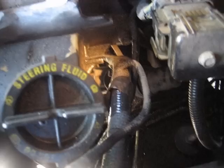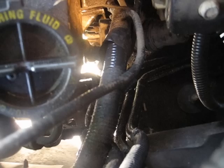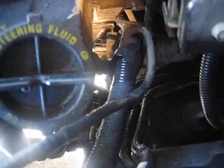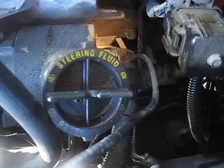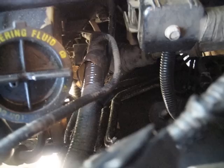Right in line with this bolt is your hose coming off the power steering pump. That's all 13 millimeters, so I took a wrench - there's a nut that goes on before that piece of bracket, and I went and broke the nut loose with a wrench, then positioned my socket back in there and spun it out. You don't want to try it any other way, because if you break that nipple off the bottom of the power steering reservoir, you're done - you have to change out the pump.